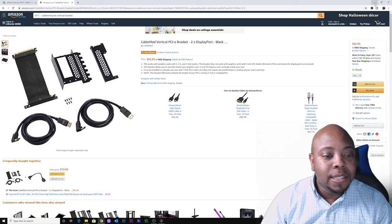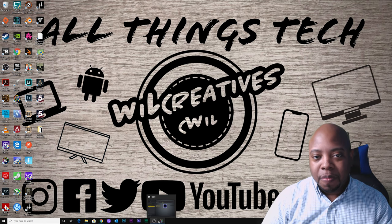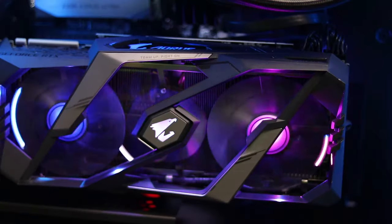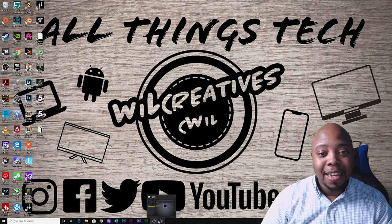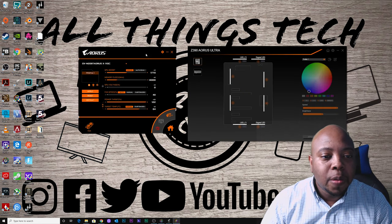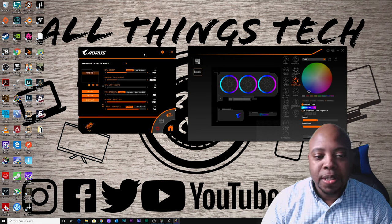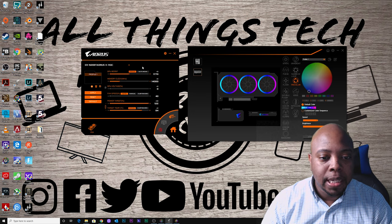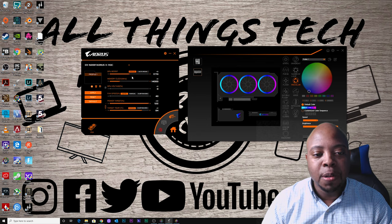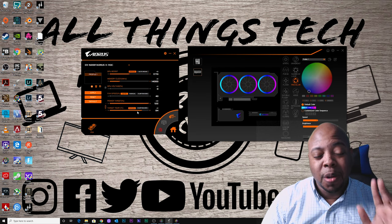All right, so to get into some of the nitty gritty about this card, one of the reasons that I bought this card is one, the performance, two, the RGB lights, and then three, performance. So let's take a look at some of the software. We have the Aorus Engine and the RGB Fusion 2.0. The Aorus Engine is designed to control pretty much all of the performance options on the card: the GPU boost, memory clock, GPU voltage, fan speed, power target, and the target temperature. We're going to dive into that in a second.